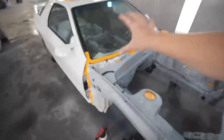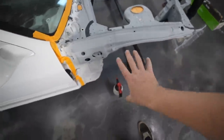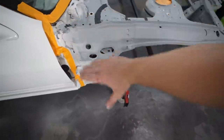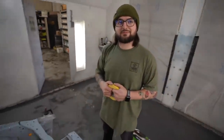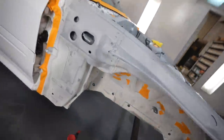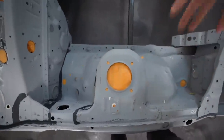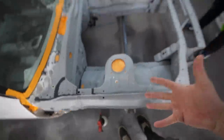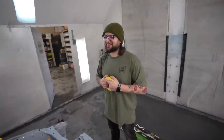The last thing we have to do is tape it up, clean it up and shoot it. Taping off all the edges that we'll be painting. This area we're going to feather out because we'll end up using an underbody or Raptor liner here. We're going to back-tape all the holes like this because with the compressed air comes dirt, and we don't want dirt. It's a dirtier area — if we back-tape it, there's no air going through it stirring stuff up, because even in a clean booth, dirt is inevitable. It's everywhere.